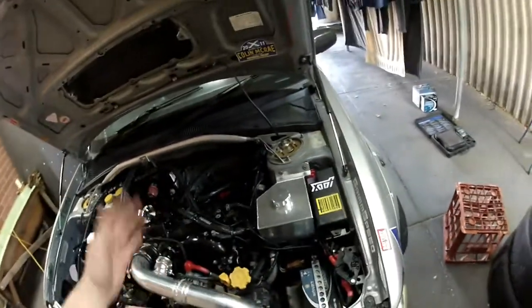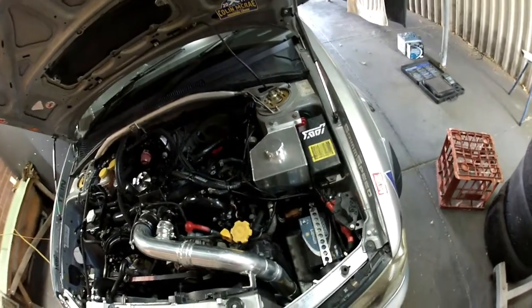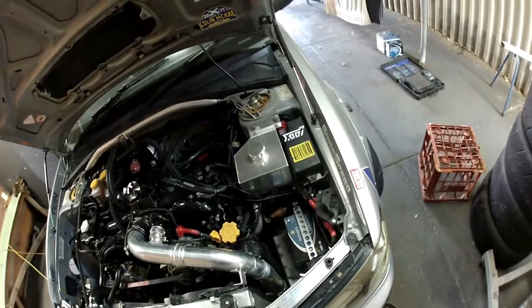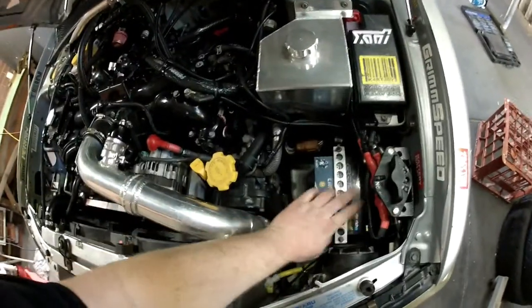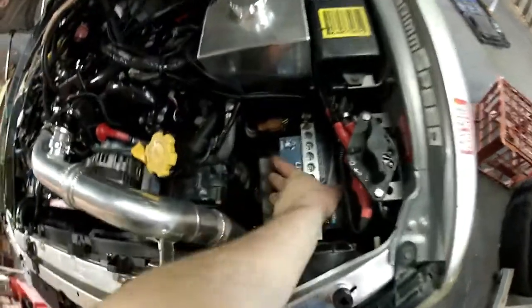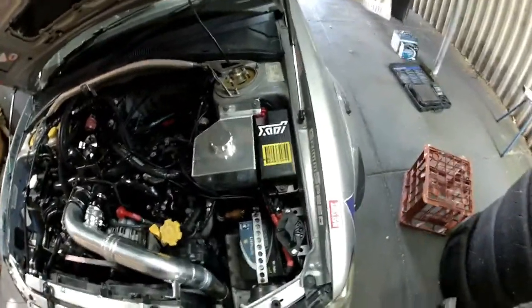In the off position it fully locks off, cuts the circuit on both the positive and the negative — totally isolating that battery, which is also not a bad idea for safety on a motorsport vehicle. The wiring involved in that probably weighs more than the battery just getting it all in place, which just goes to show you how light those batteries really are. The aluminium bracket I've made is holding it down, using the original threaded rods chopped shorter and bent again. There's a bit of foam on the bottom to help take out vibration, and all the terminals are covered with red boots to protect against short circuits.